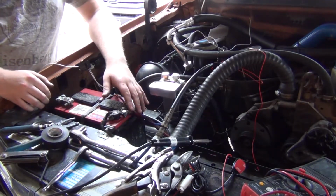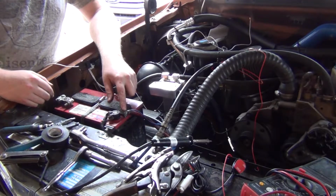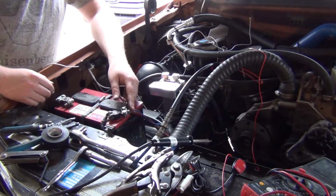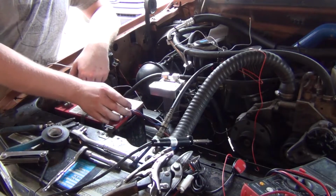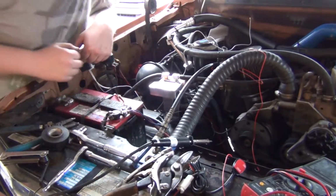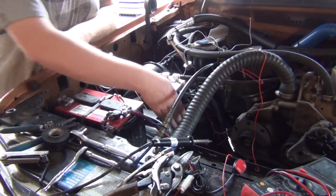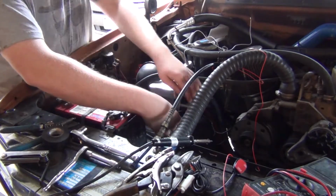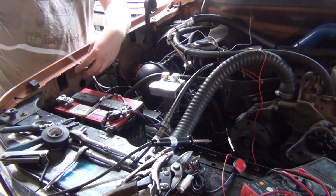This one, I got as much as I could with those, but I couldn't get it too far. I pushed the wires through it, bent them back, crimped it, and then this whole cavity that's in here surrounding the wire, it's full of solder. It's right full of solder. So that'll never have an issue with that. And then we can also disconnect it. It has a fuse here, and then, you know, we're gonna have a fuse here, so that's cool.